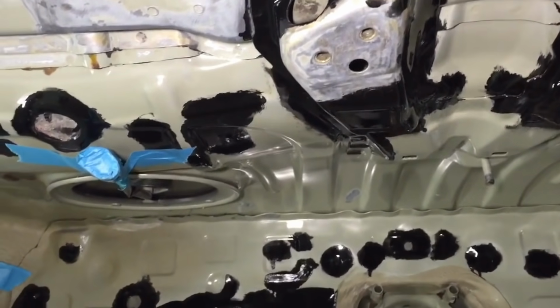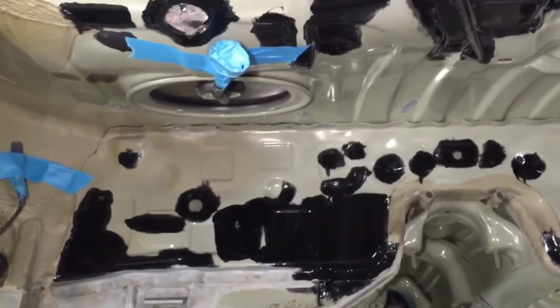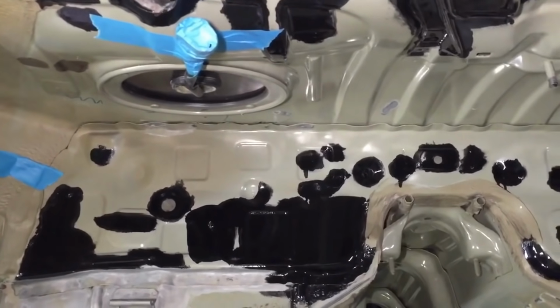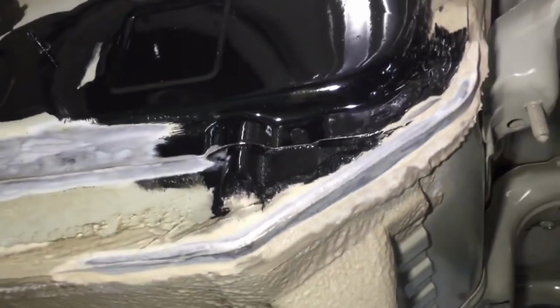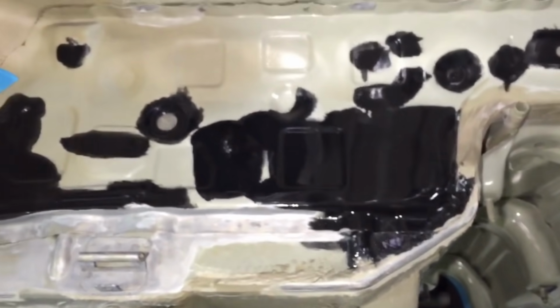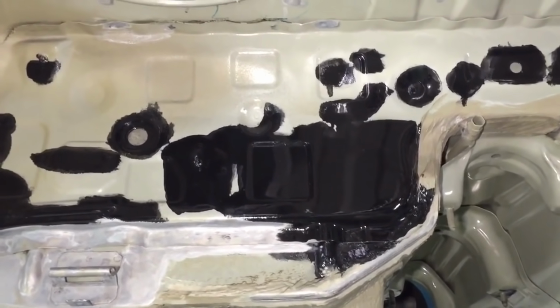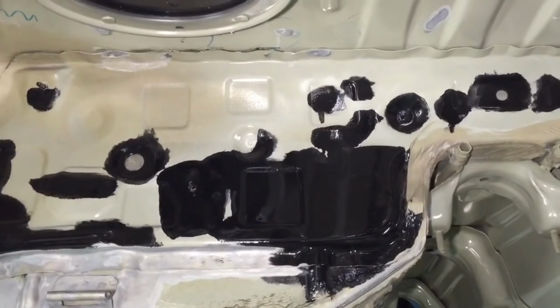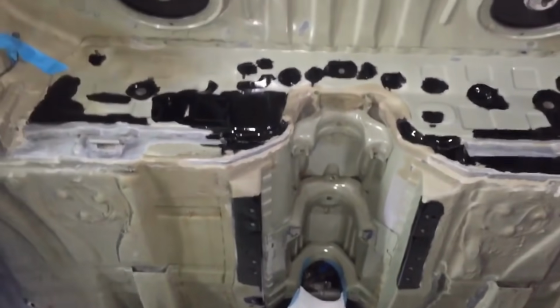We're well into the corrosion protection system now on this CSL, and we'll do it in multi-layer stages because there's so many pieces on most BMWs that are corroded. Mark pointed out in the earlier pictures, even just the small amounts in seams here, it's impossible to get all this back to bare metal in one go and coat it with the metal prep and then the 2 layers of rust preventative paint. Impossible to do that all in one go. It spans over several days because there are so many points on most vehicles that need attending to.